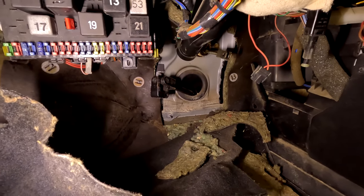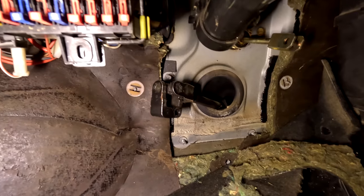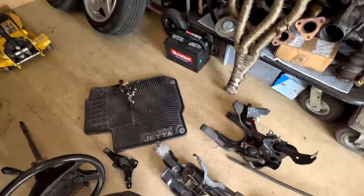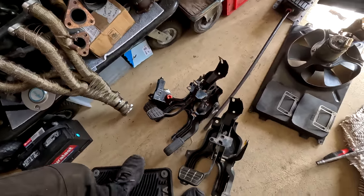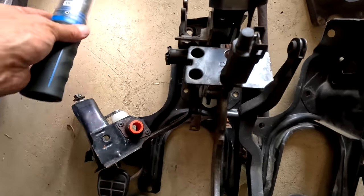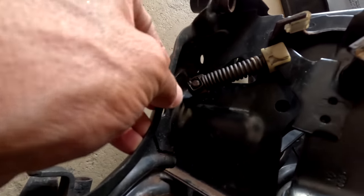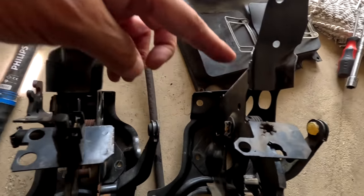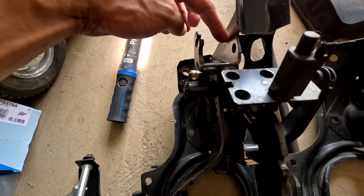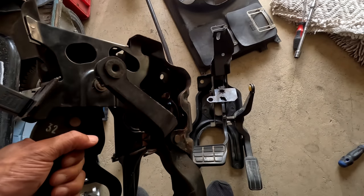She's out — she fought me, but we got her. Had to pull off the hood release cable and pull the cover forward more to get past the steering column at the bottom. Automatic pedals versus manual pedals side by side — exact same housing. Looking at it now I thought maybe I did this for no reason, but no — the manual one has the little mounting piece for the spring and the stopper, this entire welded-on piece that's missing from the auto one. So you do need the entire manual assembly.